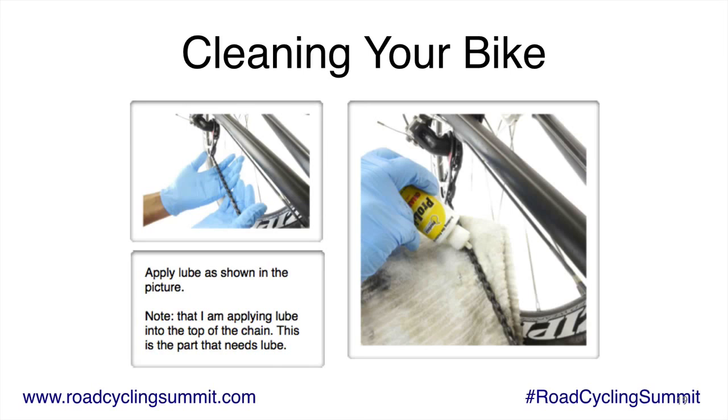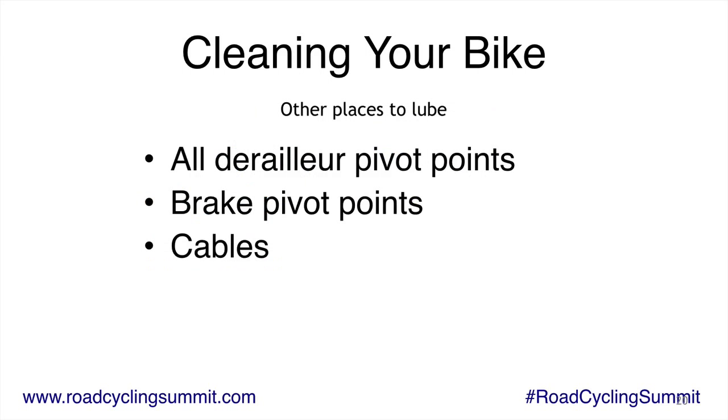And then when you're done, kind of wipe off the excess off the chain rings or anywhere you see excess lube, and you're done. And you'll see when you ride the first time, extra lube is going to ooze out of the chain. So that's the proper way to lube it. The lube in the picture there, ProLink Pro Gold, that's one of my favorite lubes. There's all kinds of good ones out there, but that's one that I do like.